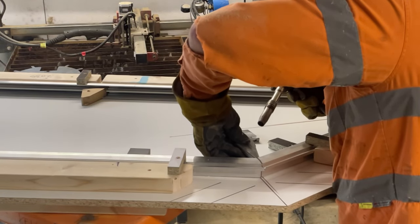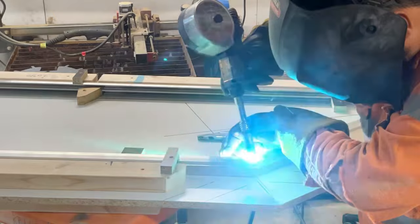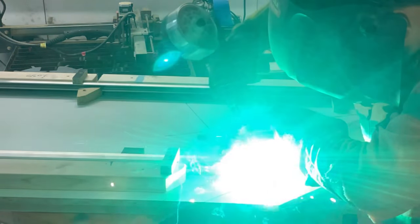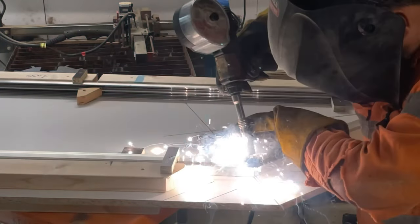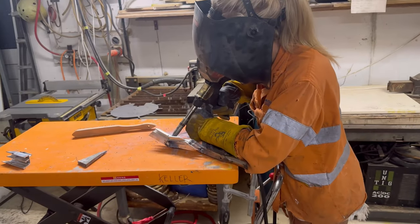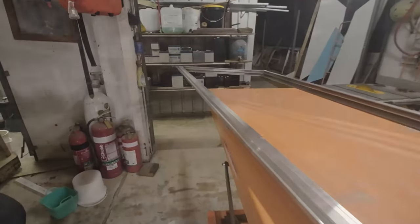I've made it too small. This is where I put the hunk of steel behind the join - the aluminium doesn't bond to it. At first I just do a series of tacks, then I do a solid finish weld over the tacks. I'm not saying it's right, but this is how I did it. After the welding's done, I just grind everything nice and flat. This is Stacy's first ever weld. We did a quick practice and she got straight onto the real thing. Welding's fun - you don't get itchy, you just get burned.